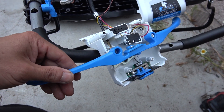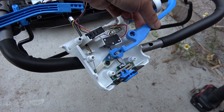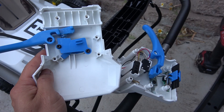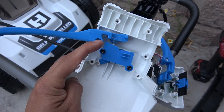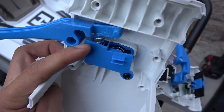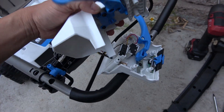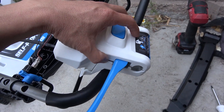Here's how you put the handle back together. This piece of handle goes in here and then into the hole. When you put this cover back, put the lever with the spring in first — the spring goes into the slot right there. This other lever does not have a spring, so you just place it right on like that.